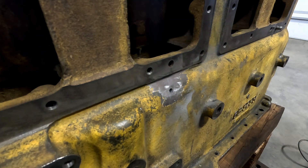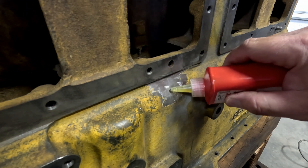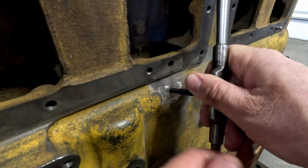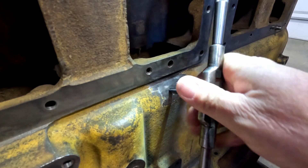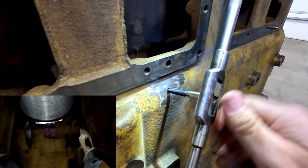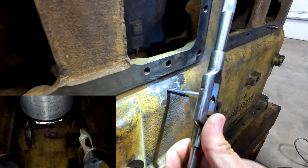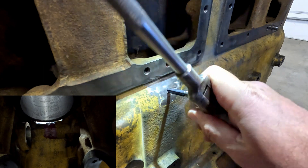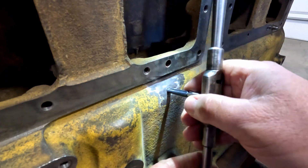I'll tap it, you blow this out with air. Put a little thread cutting compound oil on here, and I'm gonna try to mimic the angle that I went in. These are a tapered tap. They say you want to take the tap in just to where it's barely protruding out the inside of the block, and the same way with the plugs. I'm going to feel for it — I'm actually right there right now. I would go a little bit more — yeah, we'll go a hair past. We'll have to clean our tap off; that thing is sharp.